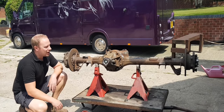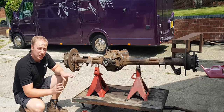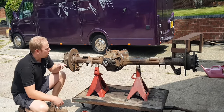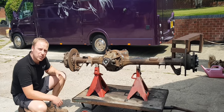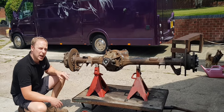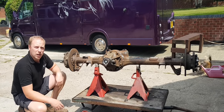Hello and welcome back to the channel. I think I'm as eager as everybody else to get on with the Land Rover again. I'm going to start with the axle — drain the oil first. Even if you're doing discs and pads you may as well change the oil because you've got to take the half shaft out. I'm going to remove the discs. I've already removed the brake pipes and the calipers. I'm going to attack it with a needle gun and I've got some flat discs as well. I'm going to rub the axle down, give it a coat of primer, and I can be changing the discs over while that's drying. I've already got the one-piece shafts from Britpart — I'll run you through those as well. I've got brand new discs, brand new calipers. So let's get on with it.